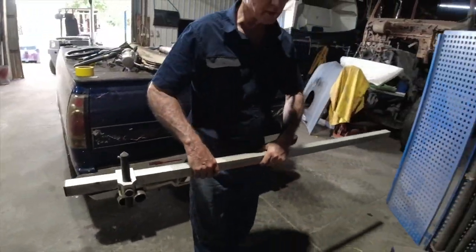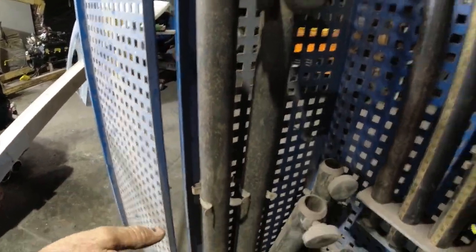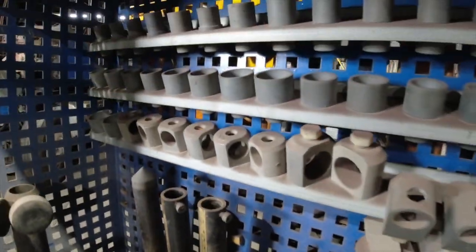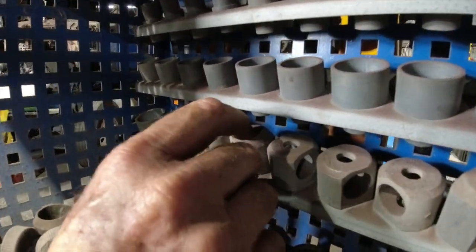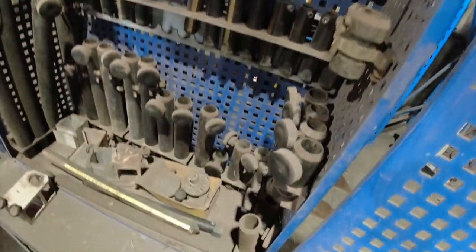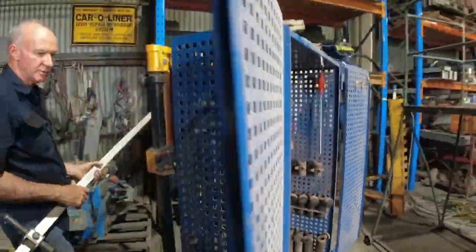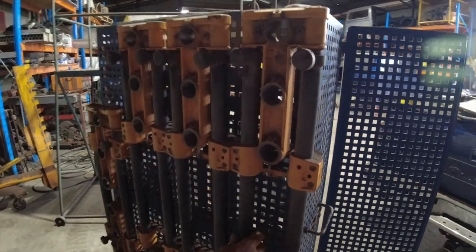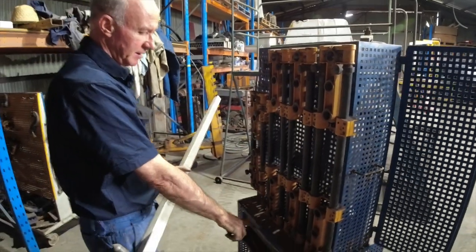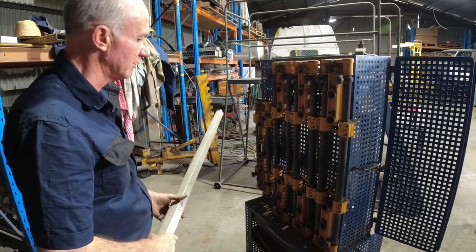Yep. And just to let you know, guys, how well these things are made, all these upright tubes are made out of gun barrel material. Everything's milled, machined to the mill. And these are all other different little pieces for measuring heads of bolts, up into jig holes and suspension components. And if you pop around this side, these are what we call measuring bridges. They'll all come off the cabinet and then they just extend out. And they've got tape measures both ends. And they lay on a bridge that runs right under the car on the car aligner bed.